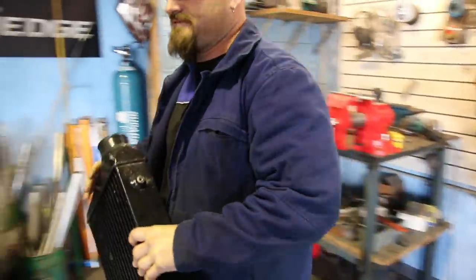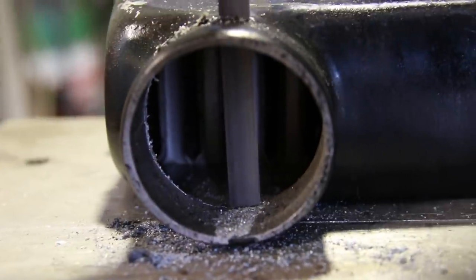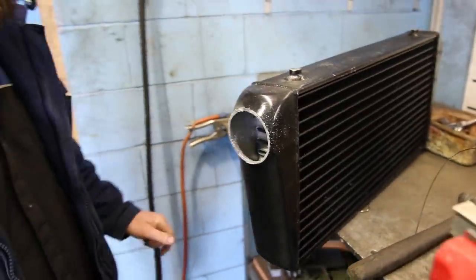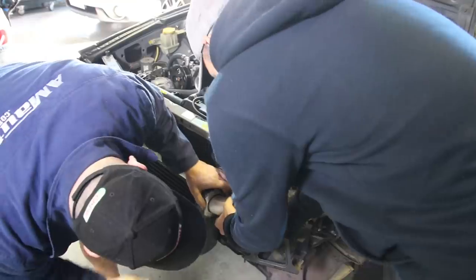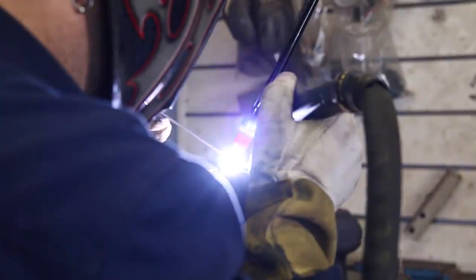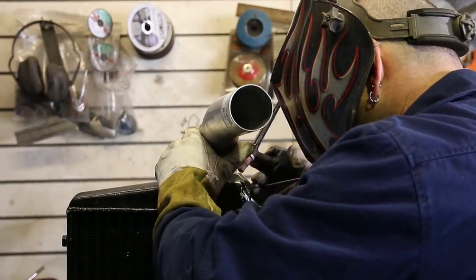Gramps is starting to look like a car again and looks like it might actually fire up, but there is still much to do. Our front mount intercooler needs pipes welded on each end so it'll fit neatly up against the front of the car. We're cutting up a 180 degree alloy bend and welding it onto each side of the cooler. With it bolted onto the car, we can start to put the front end back together. The pipes are mocked up the same way as our headers, checking for clearance on other parts. We're cutting the soft alloy using a bandsaw and finishing it with a file to make sure there are no sharp edges. We'll give the intercooler a good clean before attaching it to the car, as it will have eaten a few bits of metal while floating around the shop.